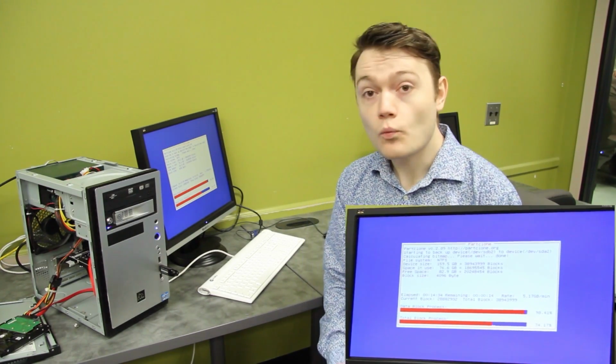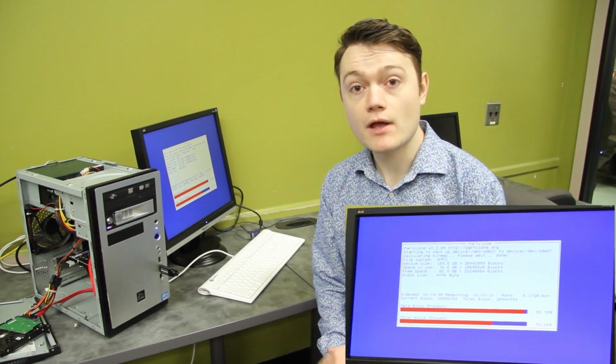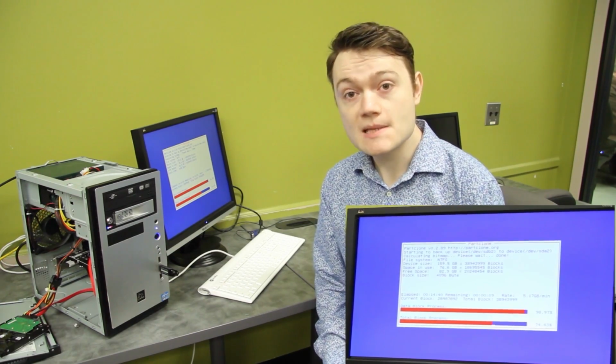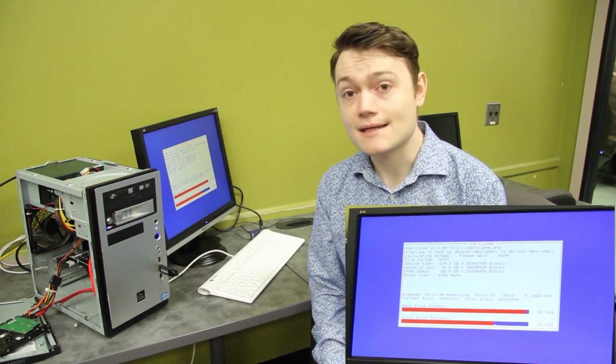Alright, so now that our Clonezilla is finishing up, I'd like to go ahead and talk about what that's doing for us today. So, what Clonezilla's done is it's essentially copied everything from the primary hard drive that's inside the computer to the secondary hard drive that we connected to the data and power cables. Now, that is going to be an exact copy.